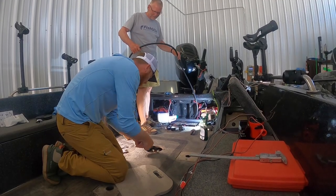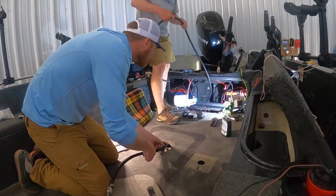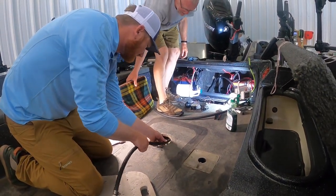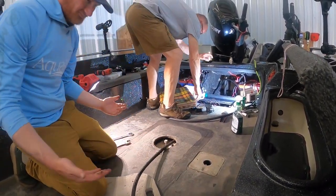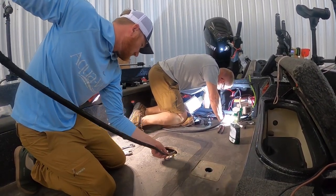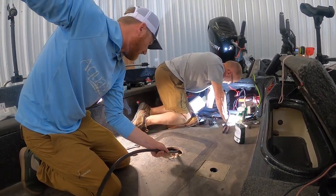Even on a new or old boat, fuel problems can be a thing — even in little gas blowers, anything that takes gas. A lot of what people don't realize is that ethanol or bad gas can eat those lines from the inside, cause them to collapse, and you have a real fuel flow issue as well as getting things into the system itself. We only had a few feet of gas line — maybe five or six tops — and once we had things torn apart it was a no-brainer to tear that out and put a new gas line in. It's a very simple, inexpensive fix. Even if it looks good on the outside, that doesn't mean it's good on the inside.